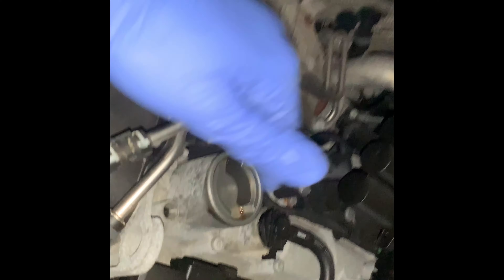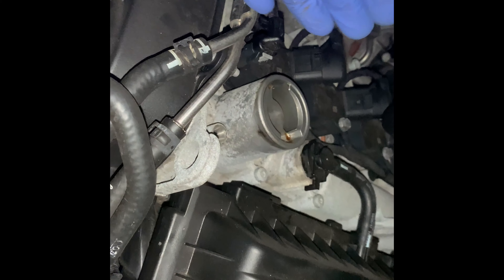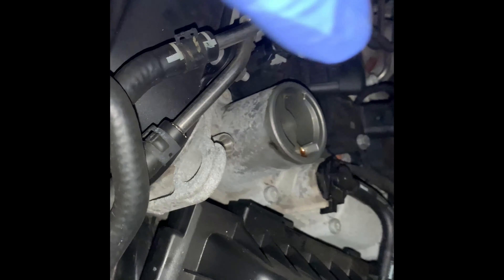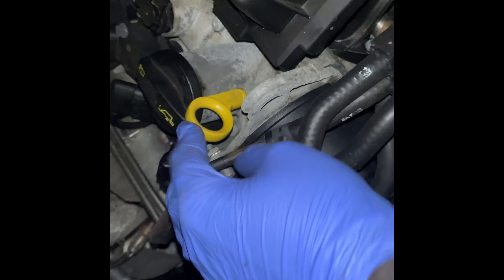So what we're going to do now is literally just top up the oil. This car takes the same capacity as mine — four litres. But what I found when I was topping my oil up, it actually took four and a bit, so let's see if it's the same situation for this car. We put the whole four litres of oil in, put the cap back on, put the dipstick back in. I'm going to start the car up, drive it off the ramp, let it run for about a minute or so. I'll also show you guys how to reset the service light.